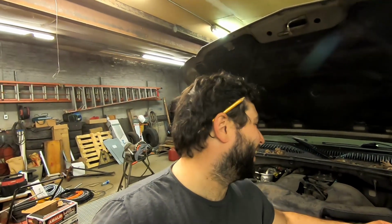Joking aside. Make sure you take good health. If you can, do what I just did on a vehicle you're about to buy. If they'll let you change the oil, get the oil filter, cut the thing out, have someone do an inspection and an oil change, whatever. If they're all right with you seeing what's inside the oil filter, you can save yourself a lot of headache. I've never done it, but trust me, I've had a lot of headaches.